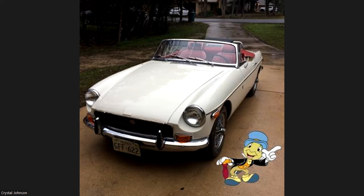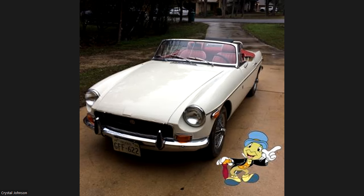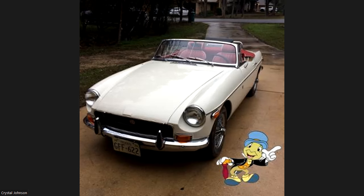Tell me about your calipers. Are they original or are they replacement calipers? They're originals that I rebuilt with all new guts. I also did the new wheel bearings and the new shims. But when I push the brake pedal, when I'm under 30 miles an hour, from the left front area, I can hear a tunk. And well, I'm not sure.